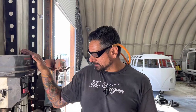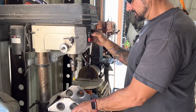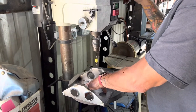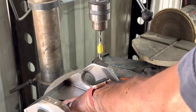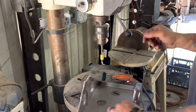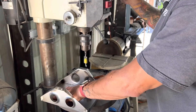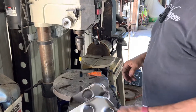Not everybody has a drill press - anything I'm doing here can easily be done with a hand drill. I'm just using the drill press because I have one and it helps me get a better job done. I've got my 7.6 millimeter drill bit in here, and when you're doing an existing hole, it'll self-center on it. It's not requiring too much to make it a bigger hole.